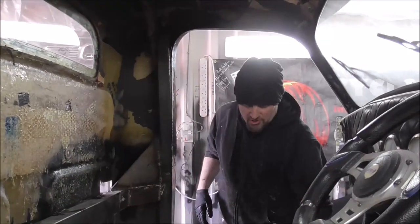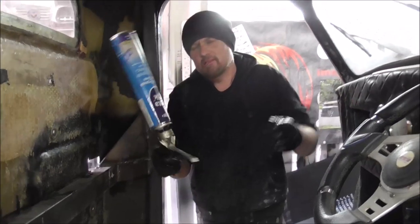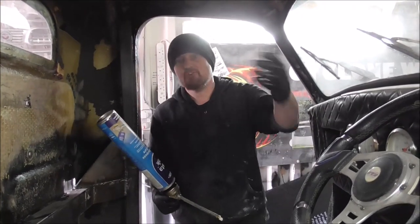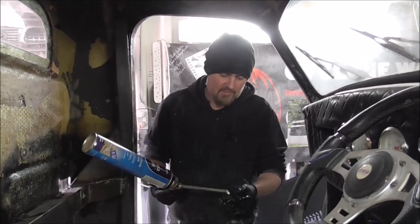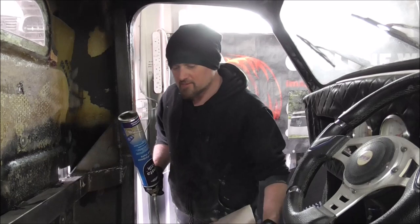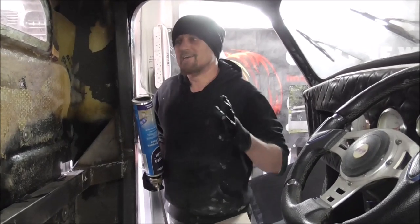and to stick something, I need full surface to surface adhesion. So what I'm going to use is this Insta-stick stuff. And this is normally used to stick plasterboard onto walls if you dry line somewhere, and it's very good. So what I'll do, I'll cover both of these boards, give it 5 minutes, let it go tacky and then stick it on.